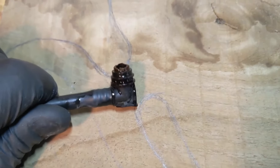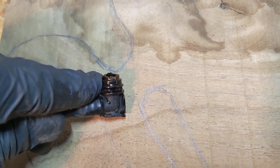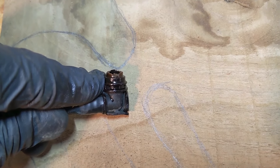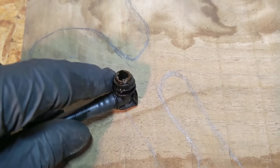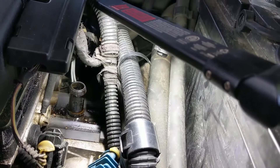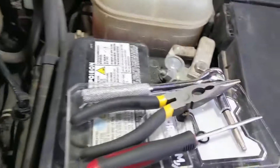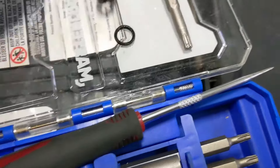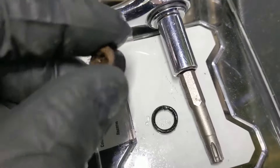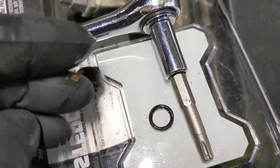This got really interesting really quickly. Here's what actually happened - here's why this was leaking. This is supposed to have a longer nipple that goes down into the hole in the spout on the thermostat housing. That broke off. There's the little tube sticking up there, and here is what came out of it. I had to use picks - a straight one and a tiny angled one - because the o-ring from that old piece was stuck down in there. The rest of that nipple had just rotted off, and I scraped out a bunch of goo from in there.